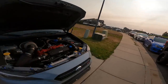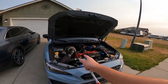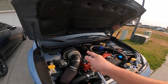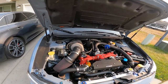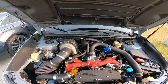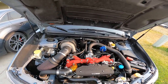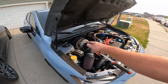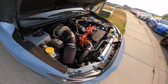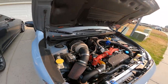We have a set of our stage 3 heads with BC 280 cams. This thing looks awesome — ETS 5 inch intercooler, ETS twin scroll turbo kit with a Garrett GTX 3582R. It does have a pretty large exhaust housing of 1.15, so it is a bit lazy. We've looked at changing that over to a 0.82 — you guys have been commenting about that and we've talked about it.